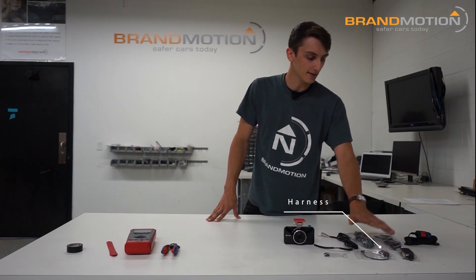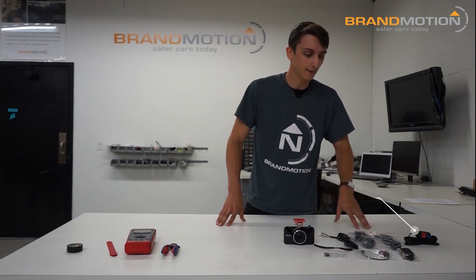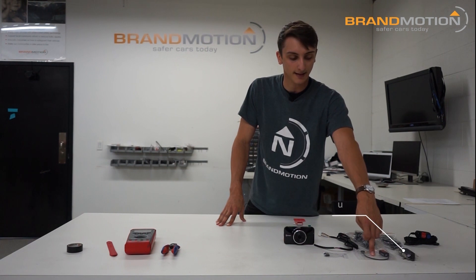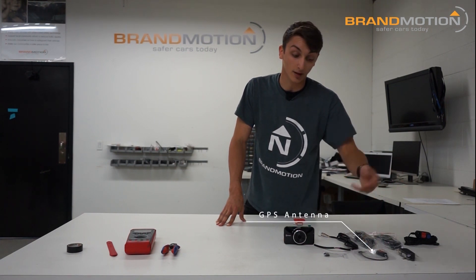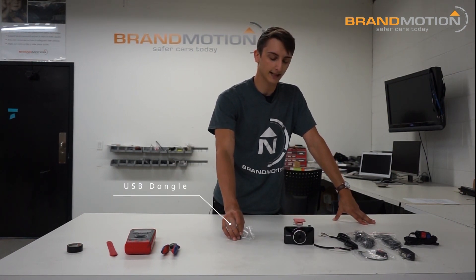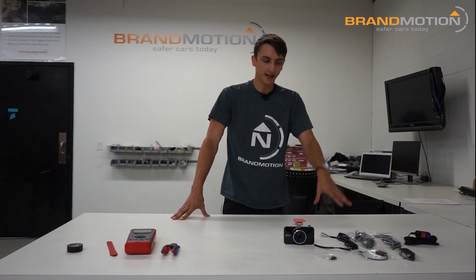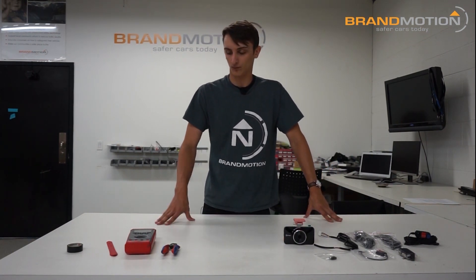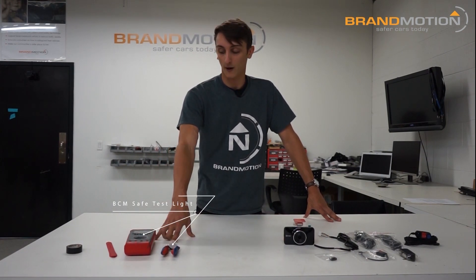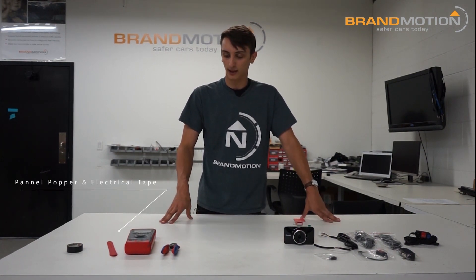There's your harnessing for both of those options. It's also going to come with a secondary camera — that's going to be usually driver facing, but it's included in the kit if you choose to use it. It's going to come with a hub, which is for one of the options of powering it up. It's also going to come with a GPS antenna — that's going to give you your speed data and location data. It's also going to come with a little USB dongle; we're not actually using this yet, but keep it handy in case we roll out new functionality. So that's your basic kit contents — it'll also come with some very comprehensive instructions. What you're going to need for the install is basically just a BCM safe fuse tap, some wire cutters, strippers, a panel popper, and some electrical tape to clean up your connections.